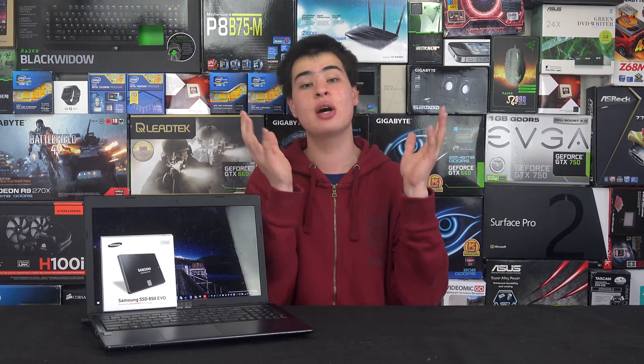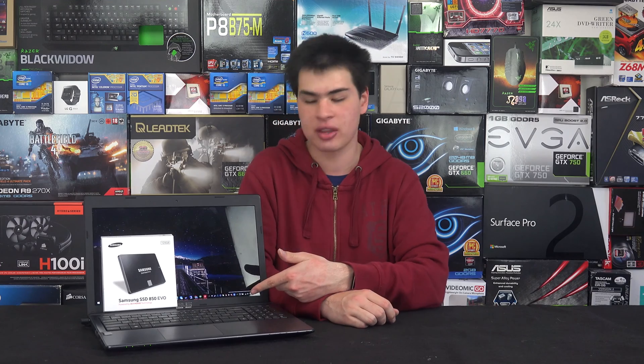Start by grabbing a new battery if your laptop holds really no charge — 10 to 20 minutes is a sign you need one. Some versions of Windows will alert you in the notification center, but not all will detect the issue. Replacement batteries are cheap; for this X55V, I can pick one up for around $50 to $70 depending on where I buy it, which is a great value for an older laptop.